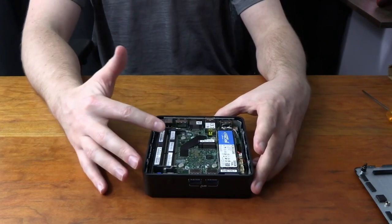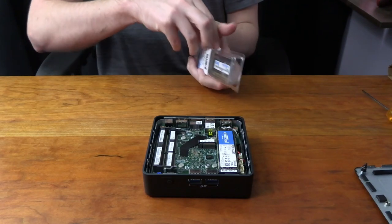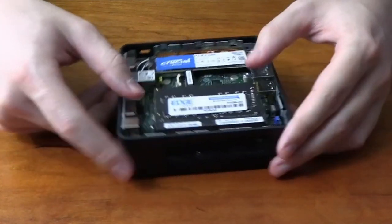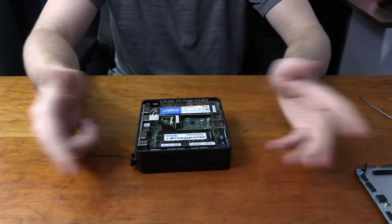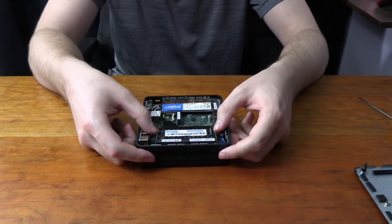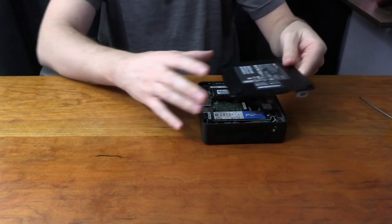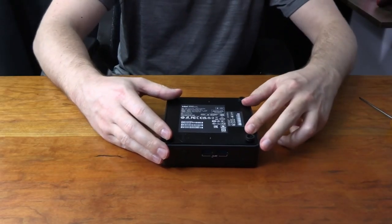Now what we need to do is install the memory. There are two DIMM slots but we're only going to be using one because we only got a one 8GB stick. Grab your 8GB stick and start installing it — just place it onto the top RAM slot at a slight tilted angle. Once you have it like that, apply it downward and it's going to lock it in place. Your RAM is installed. Also when you put it back, make sure it's pointed towards the front side of the NUC, which is the side with the power button.